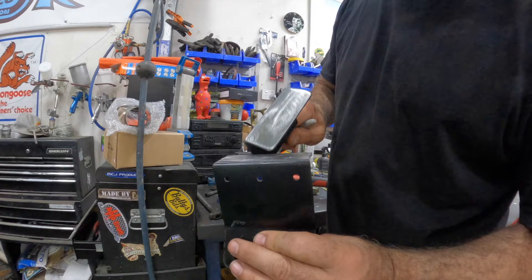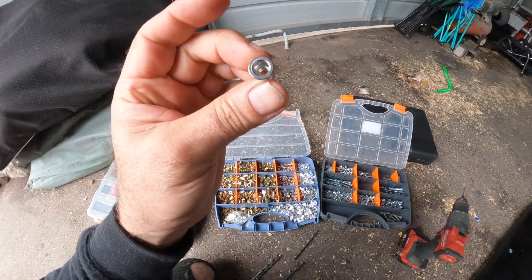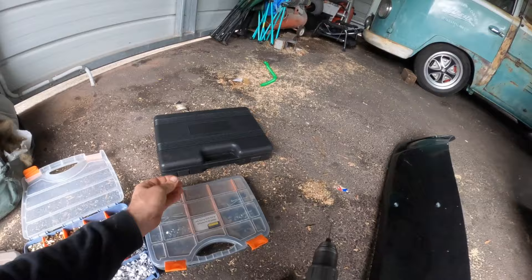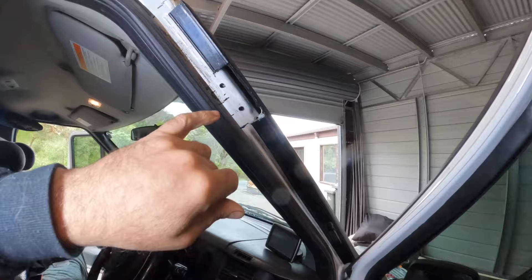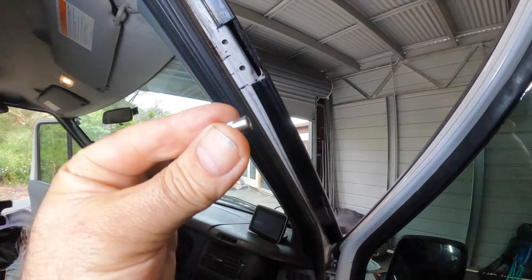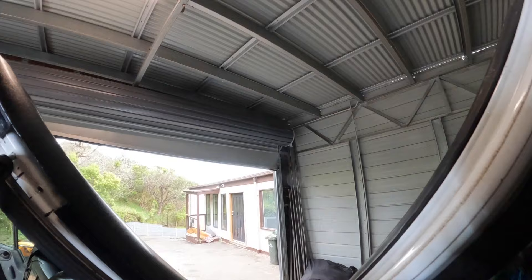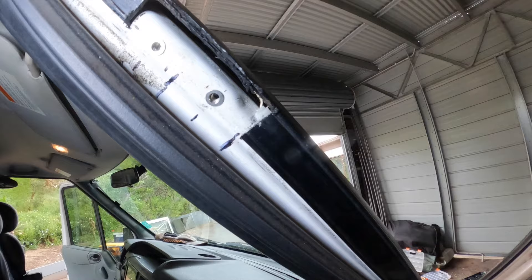We'll take this up and mark where our holes have to go, then bring it back down. We have our rivnut kit and we're going to use the stainless steel M8 — that would work quite nicely. We'll make a couple of pilot holes first and get that installed with our rivnut gun. We had some clearance issues internally so we've gone with an M5 stainless steel rivnut instead, which I think will be strong enough. They just pop in like so, then we bolt them in. Pop it in and squeeze — I'll put you guys down for a sec and get this part done.